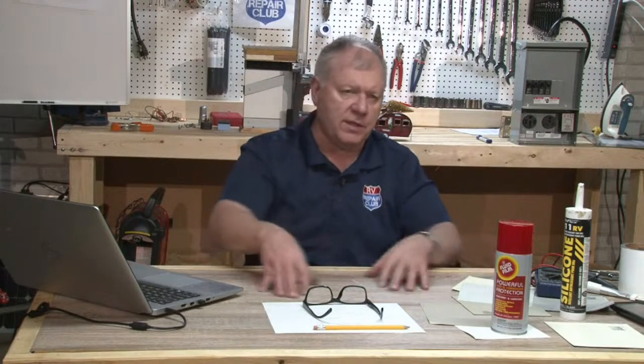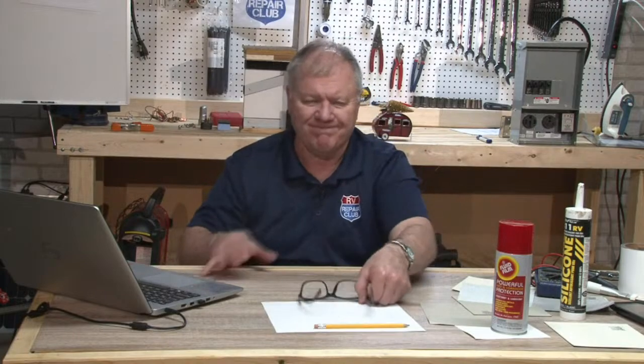You won't have that much, and it all is going to be limited to how much battery power you have, or amp hours. So you can't just put an inverter in. I know with the Winnebago, that 31-footer, you probably got two 12-volt batteries in there, but that's not going to last very long for dry camping if you're trying to use the inside stuff. And again, you will not be able to use your air conditioner with an inverter pulling off those batteries. That's got to be the electrical system. So hopefully that walked you through that a little better.